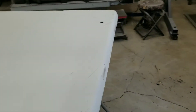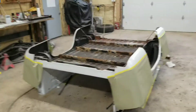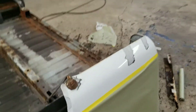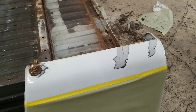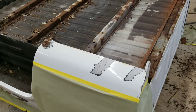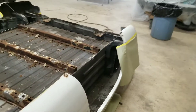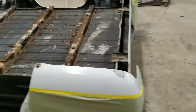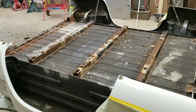Make sure you clean it good — I just use acetone on a rag — and make sure there's no wax or anything on it before you lay the glass out. I went ahead and papered up the bed so I can do these spots. I had quite a few spots on this that I didn't realize were here, and I just can't leave this kind of stuff. It wasn't really part of the repair, but my name's going to be on this. It's really turned out to be a beautiful truck, and I'm sure he's going to show it off, so I want it to look nice.